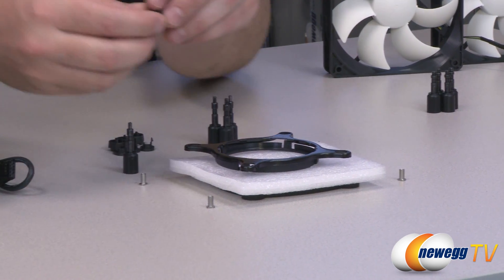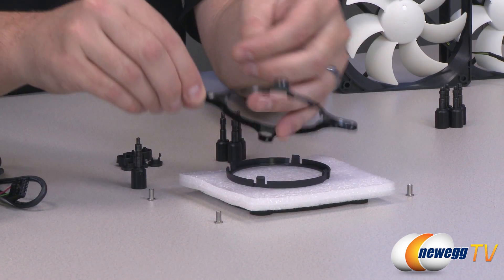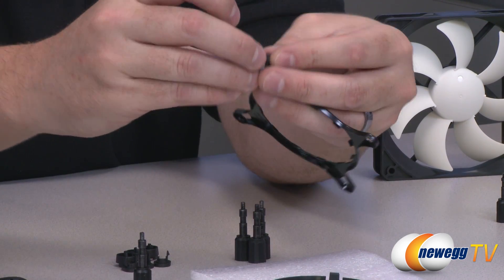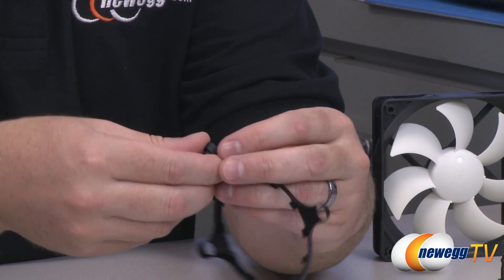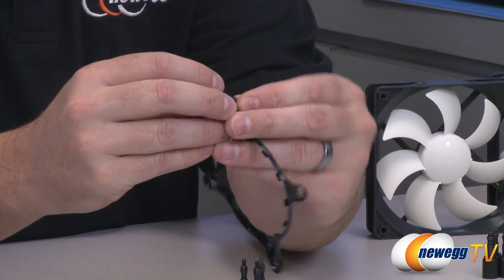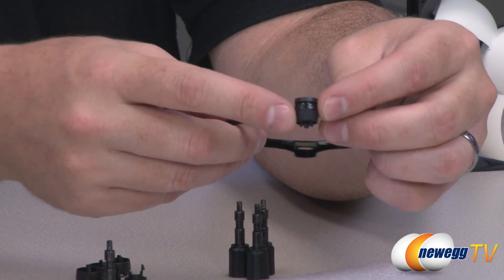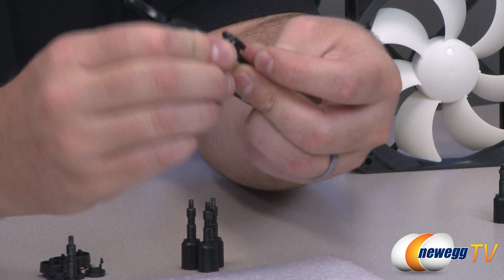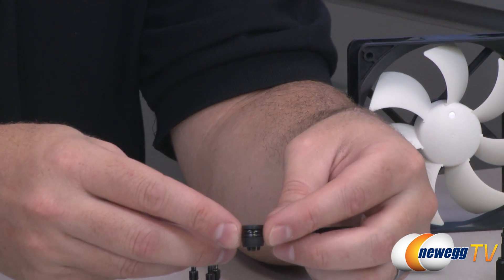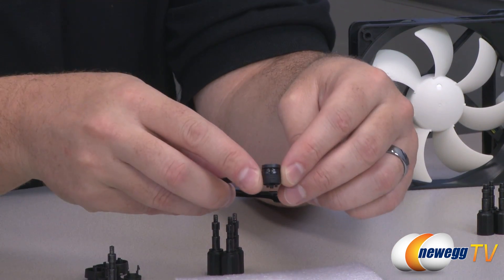One last thing: you need to take these little plastic bits — they're necessary no matter what socket you use. You snap them together on either side of the retention ring, and they can be twisted one way or another. There's writing on the outside indicating which socket you have it set up for. If you have it for the wrong socket, just twist it around to position it correctly. For instance, this side is for LGA 1155 or 1156. If you flip it around, it's set up for 1366, 2011, or AMD AM2 or AM3.